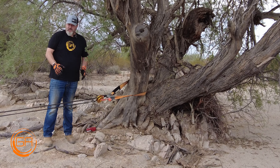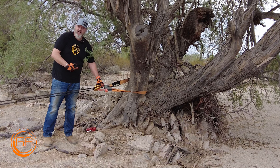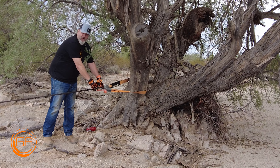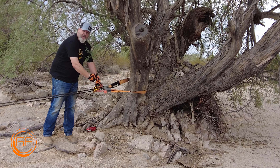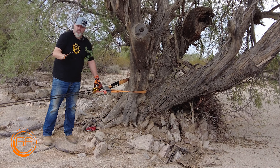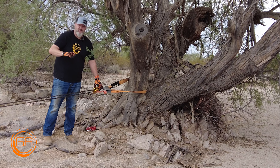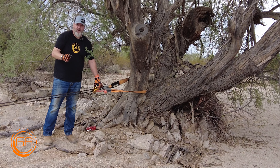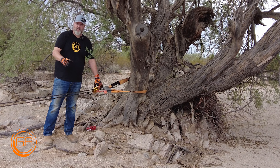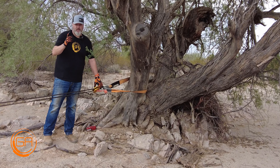That's how you hook up the gold ring snatch ring — it's a little easier because you can run the winch hook right through the soft shackle. When I ran the Jeep the line stayed perfectly fine on the ring, but yes, the line can slip off, so pay attention, go slow, and do things very meticulously. Any vehicle recovery uses heavy-duty equipment under extreme load, so wear gloves, be safe at all times, and once you've performed your recovery stow your equipment and clean it when you get home so it lasts a lifetime.